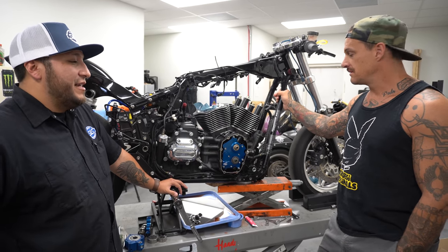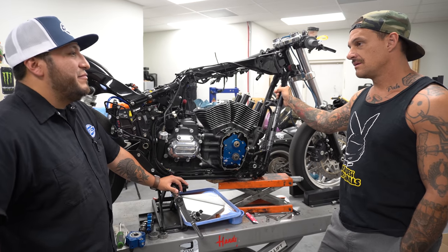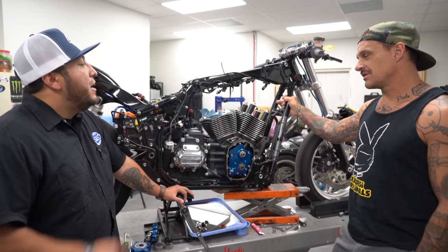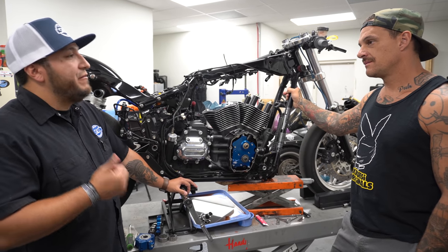Like you said, it's the best bang for your buck. These Milwaukee 8s run pretty damn good once you actually just throw a cam in there. But there's so many big bore kits out there now that we produce that everyone's been pretty excited about. Does the 128 go on this motor as well, or is that for the 114? Okay. The 107, so it's stock 4 3/8 stroke flywheels, become 124s.